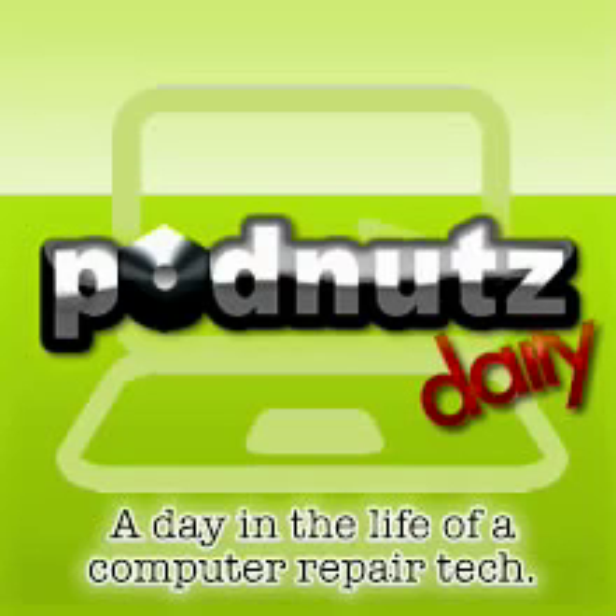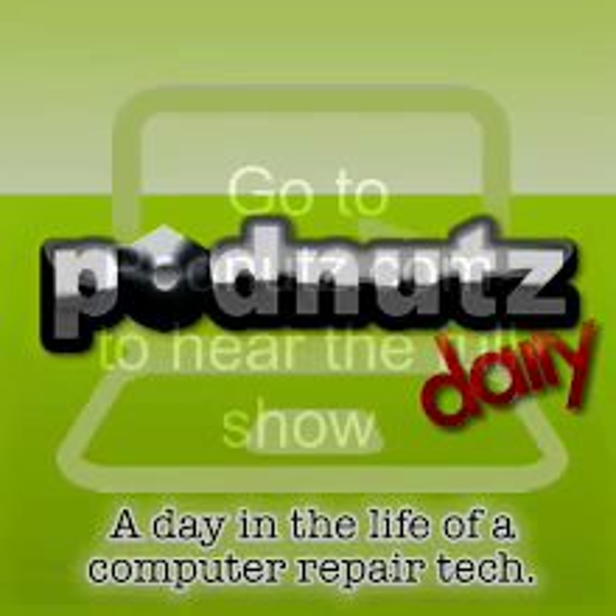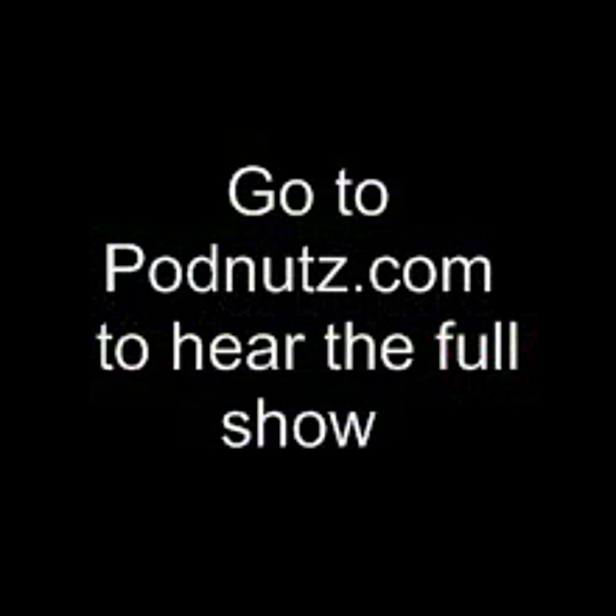There was one thing on one of the HP laptops: after I ran check disk and got it booting, when I went to the person's account, his account was all messed up — the colors were messed up, certain things were missing like My Computer not working. Things were just messed up on that user account. This was XP Professional. I ran Dial-A-Fix, ran a couple other cleanup programs, still nothing. I tried to run SFC — System File Checker — using 'SFC /scannow' from the command prompt. That didn't work either. So what I ended up doing, which I've done a couple times in the past, is creating a new account for the user. In the new account everything was fresh — all the control panel applets were in place, My Computer worked, everything was working. If that happens, I create a new account and if everything works there, I take all the data out of the old account and transfer it to the new account — the My Documents folder, the Favorites folder.